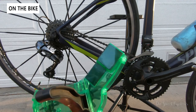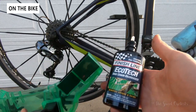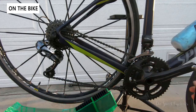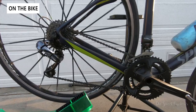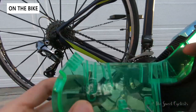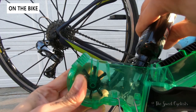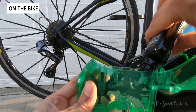Now let's set up the FinishLine chain cleaner. The first thing you want to do is fill it with fluid. You can dilute it one-to-four with water, or one-to-two depending on how much strength you need. You also want to put your bike on a bike stand so you can spin the chain around, which makes things a lot easier. There's a fluid level line, so we'll eyeball filling to about half with degreaser and fill the rest with water — the less water, the more concentrated and powerful it will be.